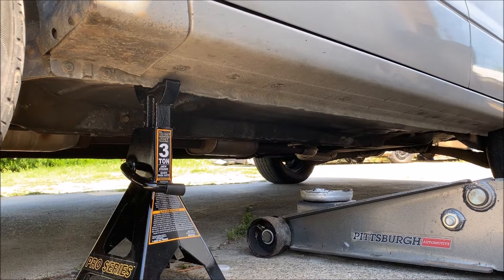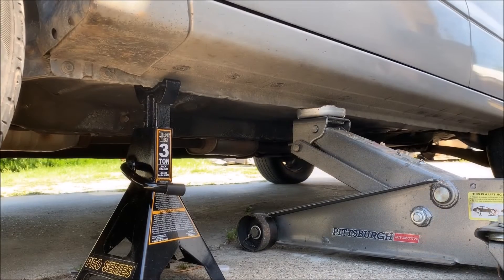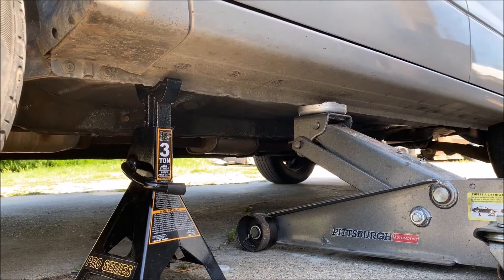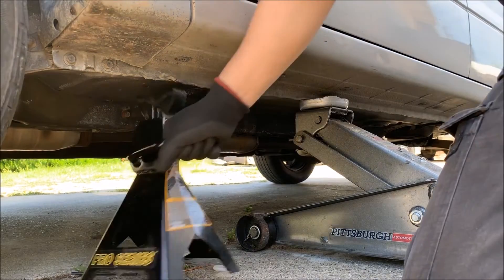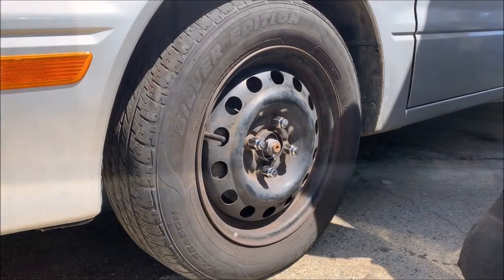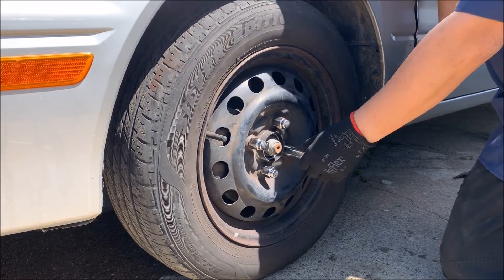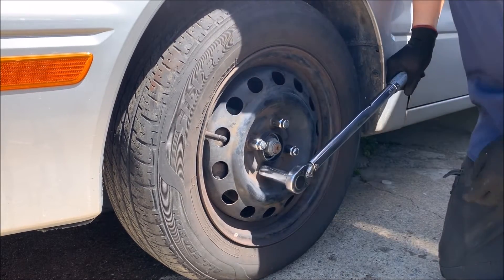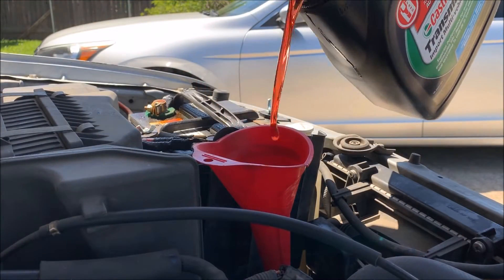With the tire in place, I'm going to jack the car up and take off the jack stand. The torque spec for the wheel nut is 73 plus or minus seven foot pound, and don't forget to tighten the bolt in a crisscross pattern. I found that a long-neck funnel works best when you try and pour in the new fluid.